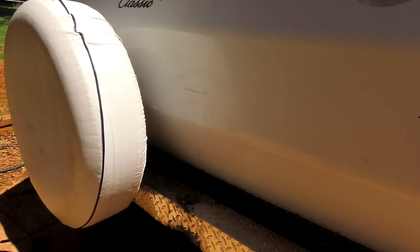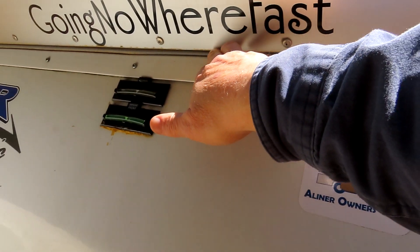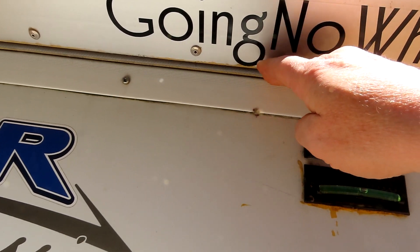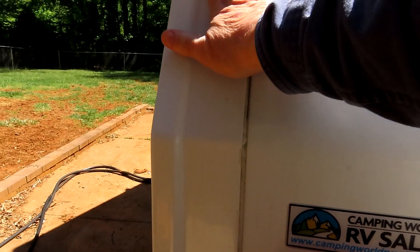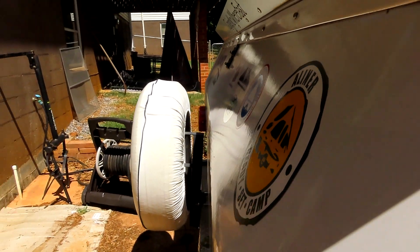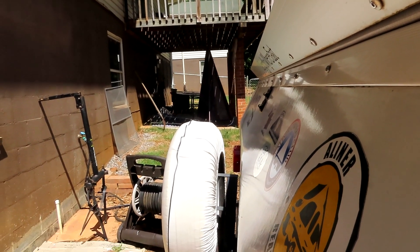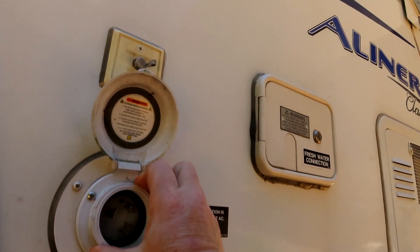While we're back here, these are the seals on your hinges for the roof. They should be firm but a little pliable — no cracks, crevices, or openings in these corner pieces, and no bulging. They should be nice and flat. The springs are right here, so if there's any bulge in the back, look down the trailer from the end — it should be a nice, straight, even view with no bulges or indentations.